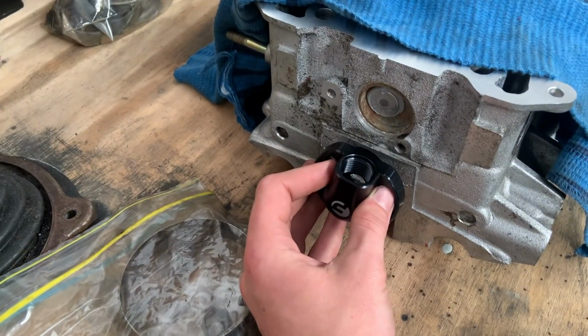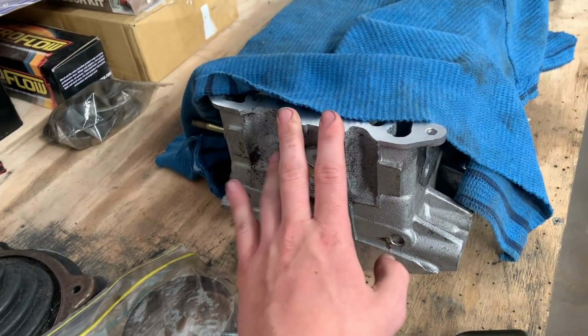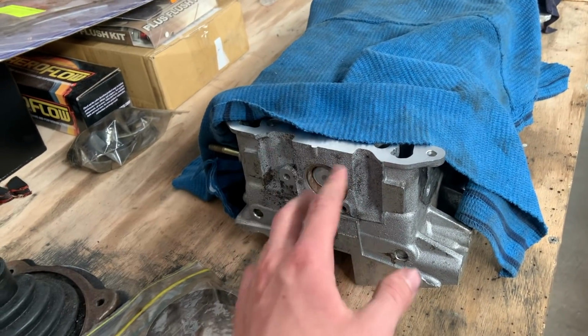And then I've got to take that, place it against the head, and then drill two holes for it to bolt to. I've got to tap them as well. Got to do that while the heads are off the motor, it just makes it easier to clean it up afterwards. So obviously we don't want any metal going into the motor. I'll be doing that at a probably later date, probably the next video actually.